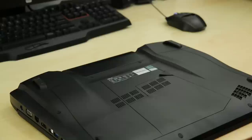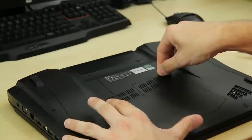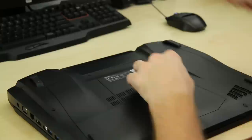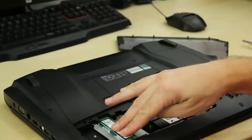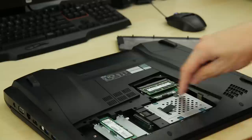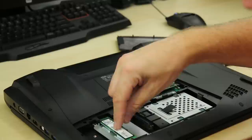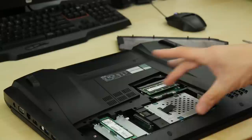I decided I wanted to talk about upgradability on this laptop. You pull back a little rubber plug, there's one screw which allows you to open up the plate on the back. That will allow you to get to the hard drives, the RAM, and you can upgrade that stuff independently. Here's the M.2 SSD — the main SSD is an M.2. Here is the hard drive, as well as the memory. You could easily upgrade the memory, and upgrade the hard drive by doing four screws. You could also undo the M.2 and put a standard SSD in, but it doesn't look like you can retain M.2 functionality while also running a standard SSD or hard drive. But you get easy access, it doesn't void any warranties — there are no warranty stickers anywhere — and you can get to the things that matter.